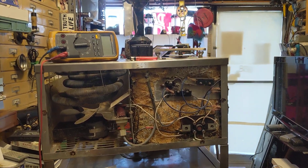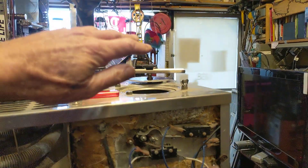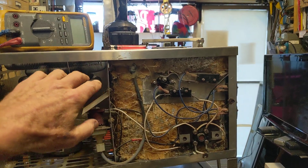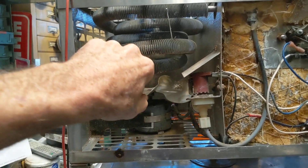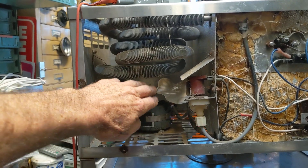When I looked the thing over, I could see that the water would have to go in right here and it had a heating element inside. Once the water is turned to steam, it would have to pass through these tubes here. These tubes have fins on them — they help cool it down. There's a fan right here, and once it cools the steam down, it turns back into a liquid minus the minerals.